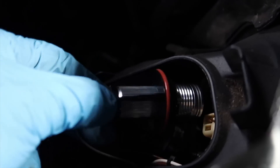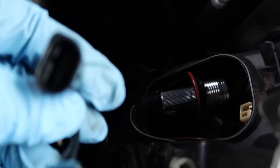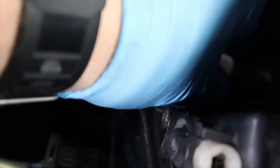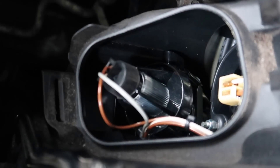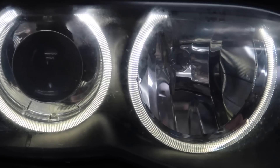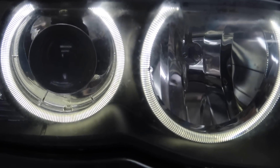They are a straight plug-and-play onto the pigtail that actually comes in the car itself. There is also a harness included — I believe that one is for the E39 — in case you don't have that plug-in harness. We're just going to pull the new bulb in, find where it turns, and lock it in. Once it's all connected, you'll find the slots with their three clips and just turn it in, then plug the connection up. The bulb is now locked in there and we'll do a test.